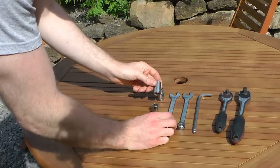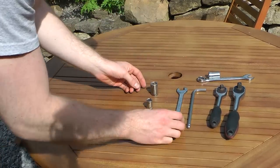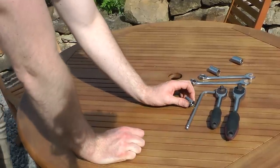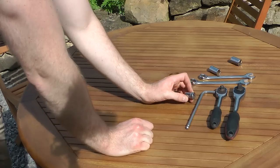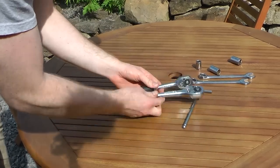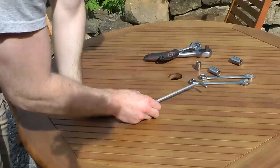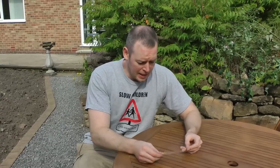We use the 16mm spanner and ratchet for taking off the stock bolts. We use the 17 for the new bolts. And 14mm was used for the U-hanging things because they didn't have nylock nuts and they were 14mm. We used two types of ratchet because it was more convenient. And this is an 8mm Allen key, which not everyone will have. If you're going to do the job, the Whiteline bolts require the 8mm Allen key — it's probably the only thing you don't have in your socket set.